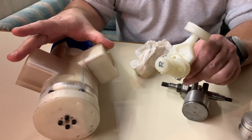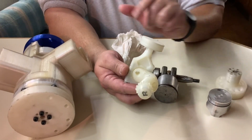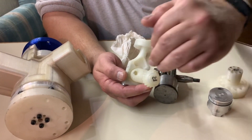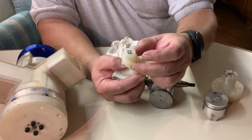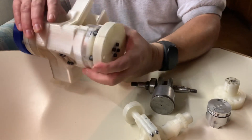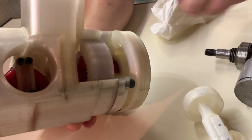The geometry relationships at play here — this model is of a 120-degree V, but it can be any V angle. The crank pins are displaced about the central axis of the crankshaft by twice the cylinder V angle. The distance from the crankshaft centerline to the crank pins is one quarter the stroke. The pinion gear diameter on the nose of the crank is equal to half the stroke. There is a ring gear at each end of the block whose internal ring diameter is equal to the stroke.